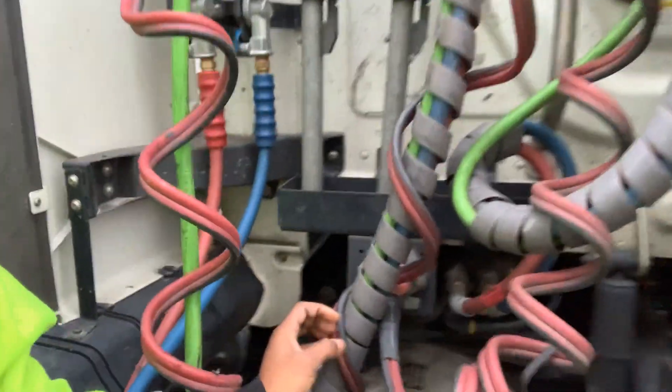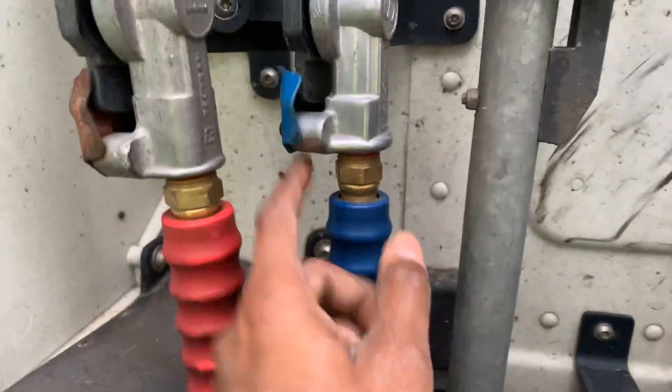I pulled out slowly and it just kind of disconnected everything, so luckily nothing was messed up. But for people that have a heavy foot and like speeding — if you sped out fast from underneath the trailer — you can end up ripping the whole glad hands assembly off. You see how this is screwed on? You can end up ripping this whole piece off. It's not the end of the world because it's easy to replace, but who wants to spend unnecessary money when you can just pay attention? I think that day I was really tired.